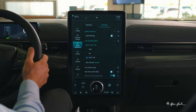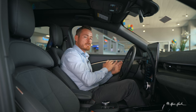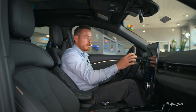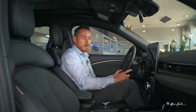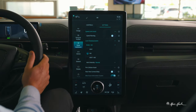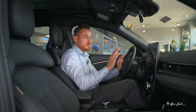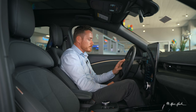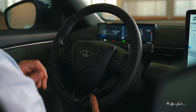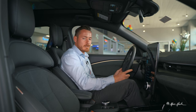In alert-and-aid mode, the wheel will both turn and vibrate to notify you when you're drifting. Personally I prefer aid mode only — the vibration can startle some drivers. If you don't want lane keeping on side streets, there's a button on the steering wheel to turn it off, and you can turn it back on when using cruise control or Blue Cruise on the highway.